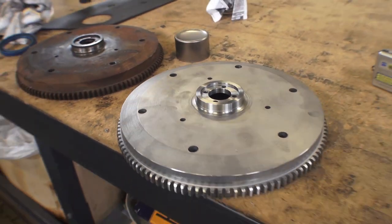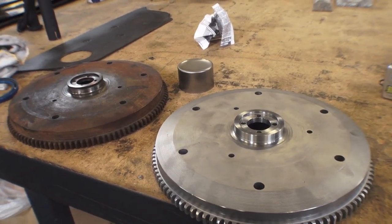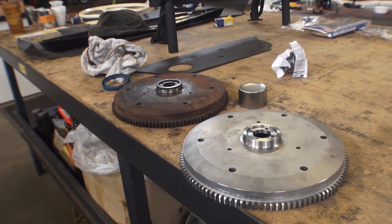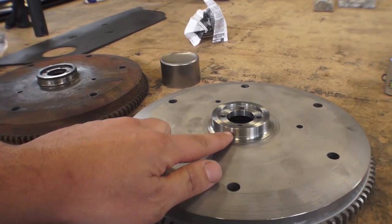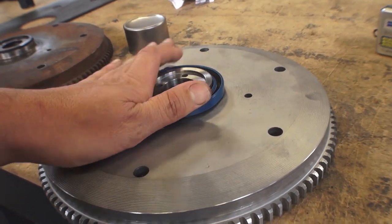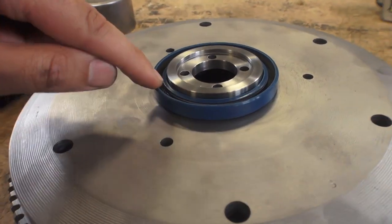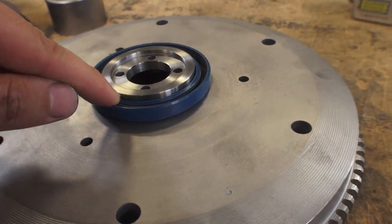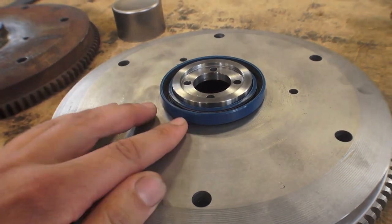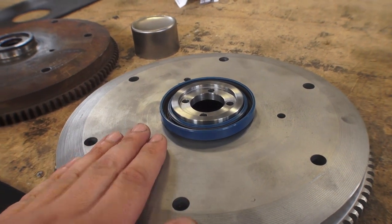Basically that's the tip for today guys. I know it was a bit long winded, but I wanted to point this out to a lot of guys out there that are constantly changing their rear main seals thinking that's going to rectify their oil leak — and it does not. Because if you still have that groove on the neck there, it's not going to stop the oil leak. You can test it yourself. See, that's nice and tight. You put the rear main seal on. As you see over time, that ridge cuts the groove into the neck with an old seal — it's hard steel, but it'll do it. So you want to get that neck nice and smooth, and that should stop your oil leaks.